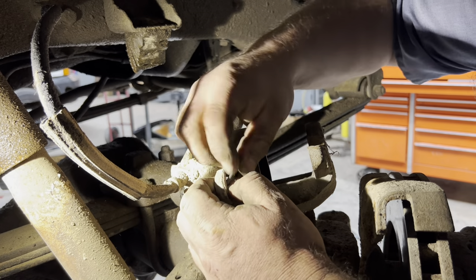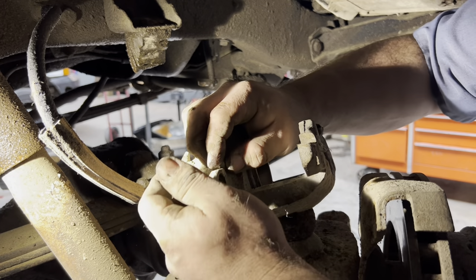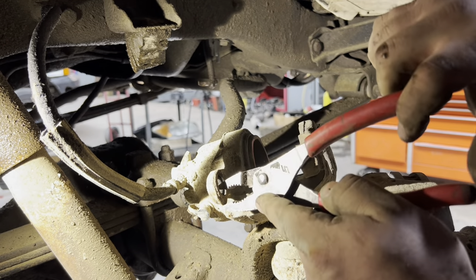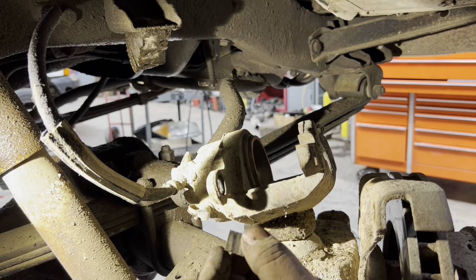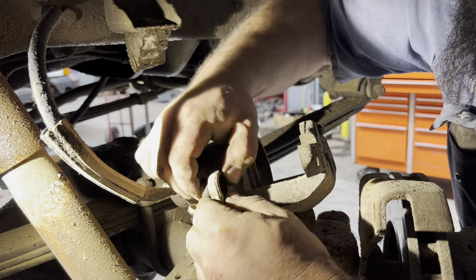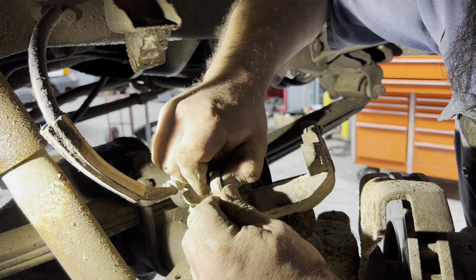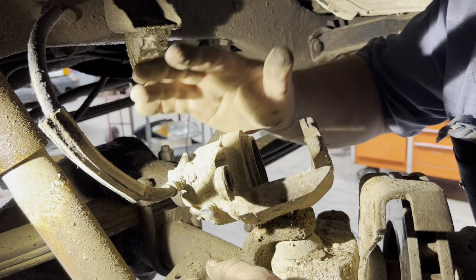Okay, I've got some O-rings here and we're going to stick these in there — they're not the right ones, but oh well. I found something a little bit fat because everything is worn out. You take it and kind of squeeze it down in the groove that's in here, then take your thimble — preferably the shiny side towards it, but there is no real shiny side — and work it in here, trying not to knock it out of the groove. Wiggle it, rotate it, do all kinds of stuff. There we go, it slid in. That'll take up all the clacking clackety-clack I've been hearing up here.